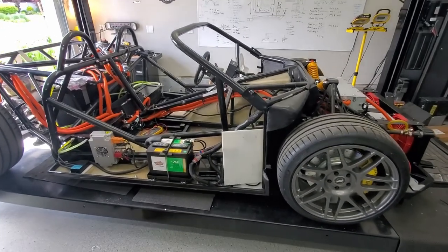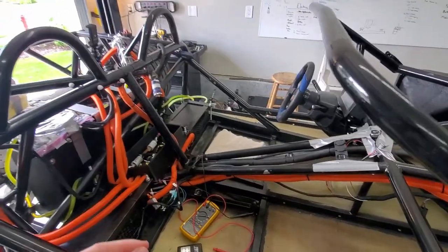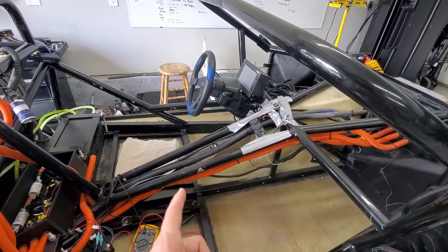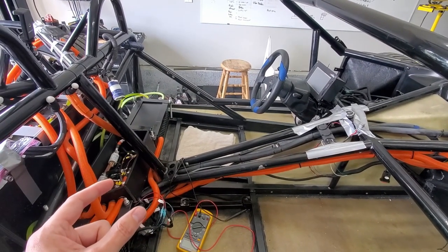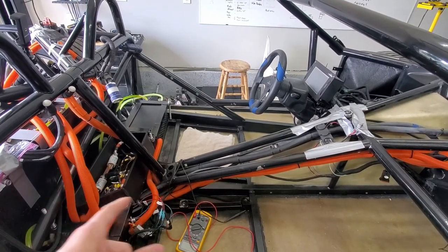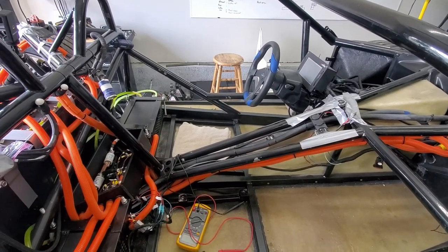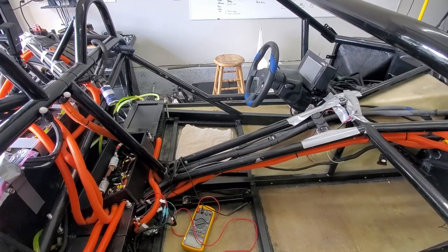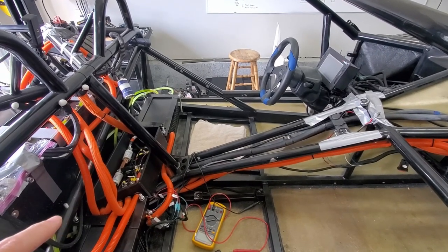So the first issue is found that the contactors had been welded shut. So the condition where we were in the boot cycle, when I thought I fixed it, I think what I did is I ended up welding them shut. So it got out of that cycle because they were already closed. With that being said, I don't feel comfortable anyways running things again. So gotta fix that and just gotta figure out what's going on.